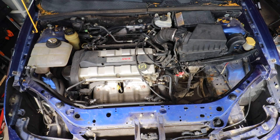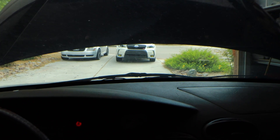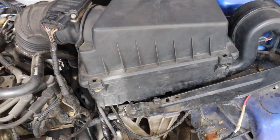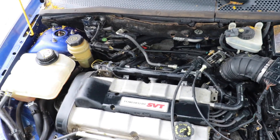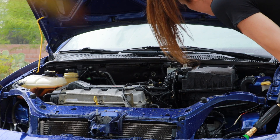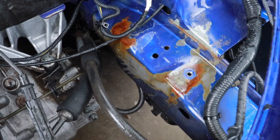I know this is a rally car and I'm going to take it in the dirt and get it completely filthy, but while I have the headlights off, I want to clean the transmission and the front half of the engine and get it nice and spotless so that if there are any oil leaks, it'll be easy to find them. I covered the transmission in some etching Mach wheel cleaner to clean up the aluminum, then went over everything with a regular degreaser. I found a lot of dirt and grease by the fuel rail. I also blasted away a lot of paint that was eaten away by old battery acid. Eventually I'd like to pull the engine and paint the bay, but that's why I need a shop — I need a shop and a crew.